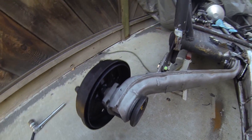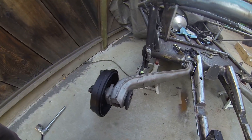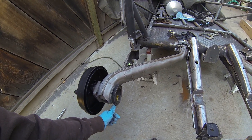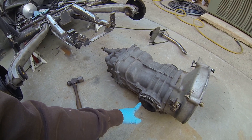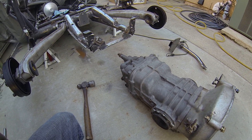I'm using the VW swing axle drums. My axles are the Porsche 930, so I'll be able to use bus CVs on each end — bus CV here, bus CV here — and then the standard VW car axles.